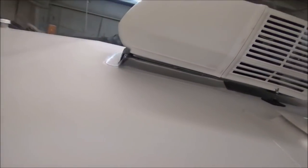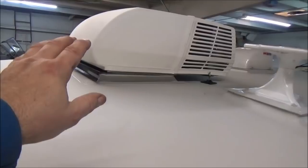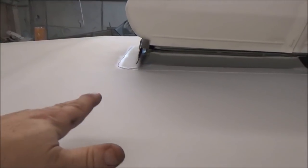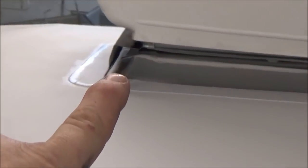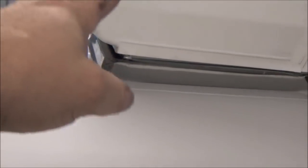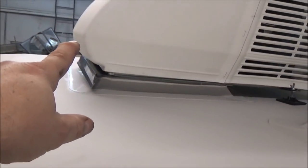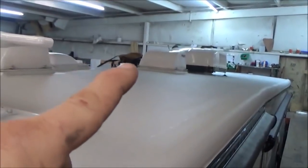He had a vent in here — you'll see that flashing on there goes up underneath that cover. Same principle: it rolls around. You can see up inside there — that little flange right there is aiming down. So any water that tries to come up this way from a driving rain, if you have really heavy rain and you're traveling and it's just gushing across the roof and tries to ride up, it's going to hit that flange and roll out. The counter flash right there means it can't get up and around. Water that rolls down will go up underneath below this flange and then roll out. This is a Coleman unit and that one down there is a Dometic — that's why there's a difference on the flashing detail. Everything's been double layered — all the caulking double layered.